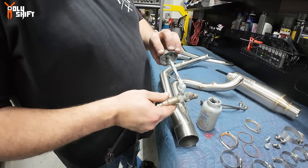The bigger the bolt, you want to go with red. From a quarter inch down is specifically blue. Why is that? Because the screw is so small that it's not going to do a whole lot, it's going to need to be held in. As well, when you have a stronger bond in there, you have a higher chance of breaking the head of the screw off, or breaking the screw off in the hole, or causing a problem. I got you. Okay. Thanks. No problem. There you have it.